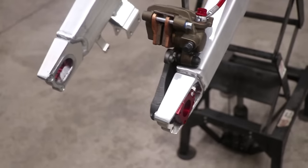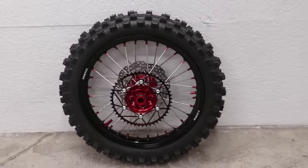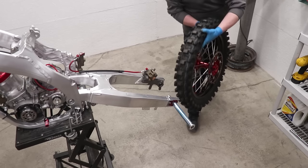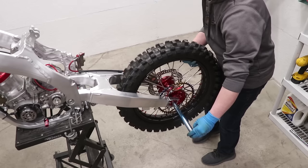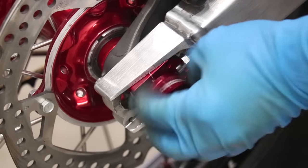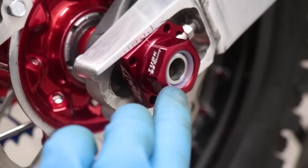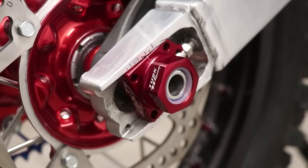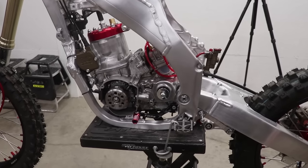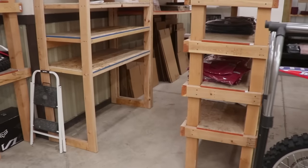One more thing: when you're adjusting the chain or tightening the axle to pull the wheel forward, with these axle blocks you don't have to throw a wrench or rag between your chain and sprocket — it'll already pull that wheel all the way forward. I picked up this trick little nut from Rocky Mountain — it's a Tusk brand, looks really cool, and it's got a little nylon sleeve on the end so no need for Loctite or a cotter pin. I'm going to leave this loose until I get the chain on and adjusted. I'm really glad I went ahead and did that zinc plating on the hardware — it looks so much better than it did before.